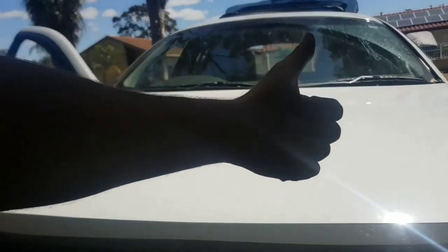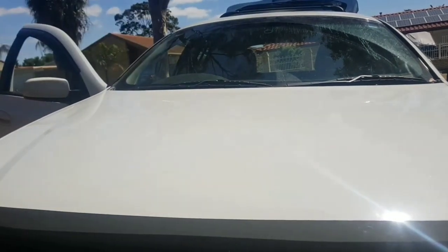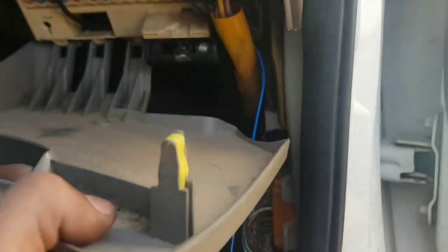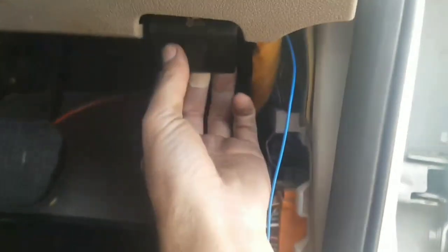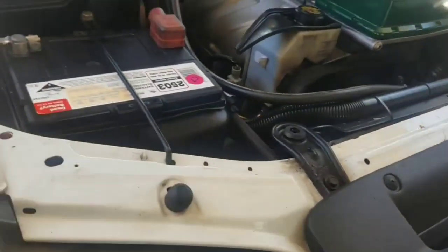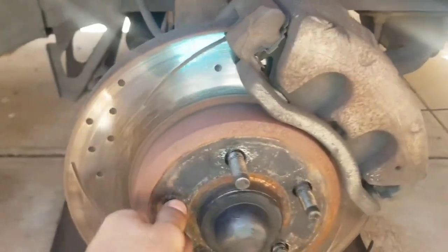Finally, I wanted to make sure the weather shield grommet inside the cabin was all sorted, so I went through to double-check on that. Such an awesome little thing we can do on our own — it saves so much hassle compared to using side pliers, especially for mum being a bit elderly. To finish off, we seat the last of the rubber grommet under the guard to make sure it's nice and weather sealed. I found I was able to pull it out slightly and seat it in place, then go and put the inner guard lining back on — and that's it, guys. Awesome.